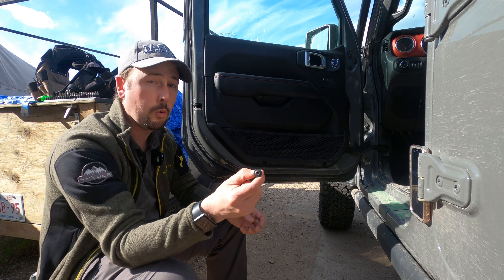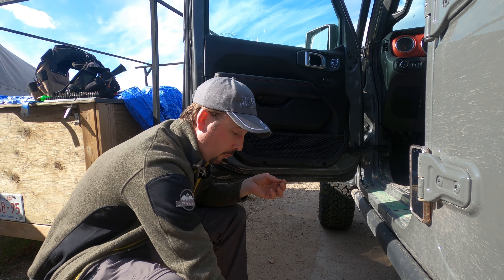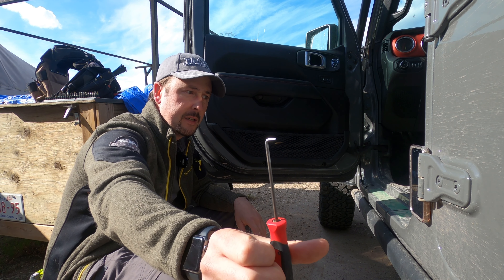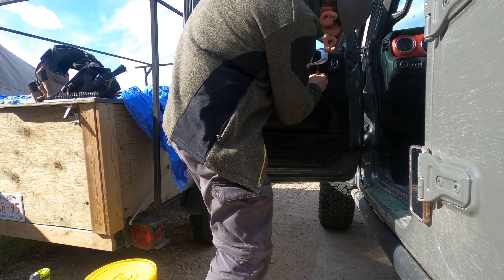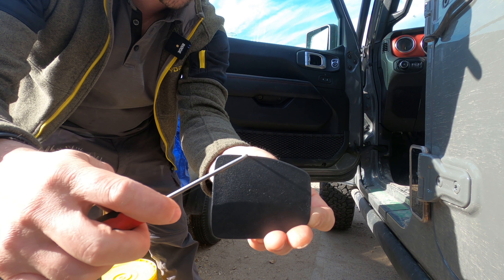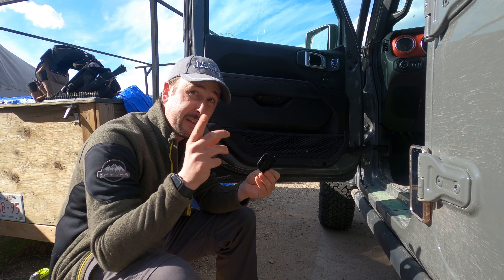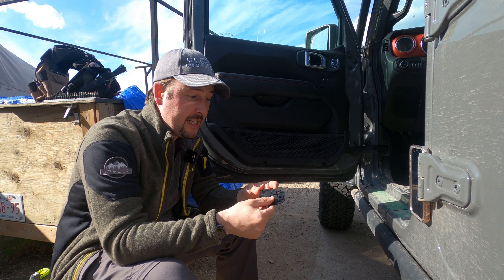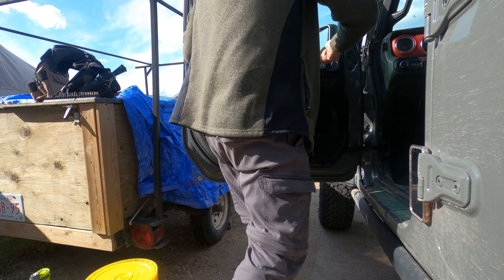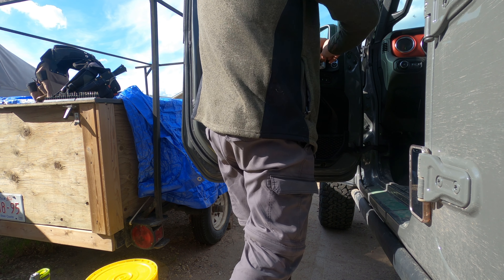I notice that underneath here there are two bigger Torx screws holding the door panel, and two small ones down at the bottom — those are the obvious ones. But one you may not know about is there's another one at the top. If you grab a pick shaped kind of like this, you'll see right inside the door handle at the very top — you just pop that in there and it slides right into the notch. Be careful with these because if you're too rough, I've already had one break in the back seat.